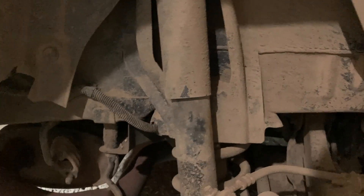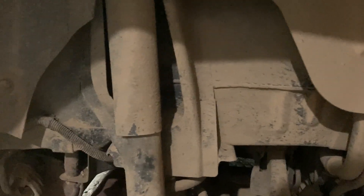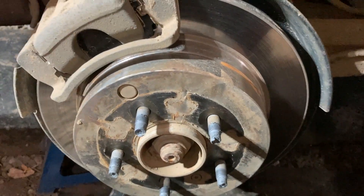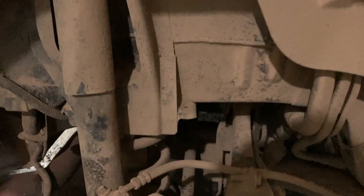It's really dirty in here and I've got to pop some plastic rivets. So I've got my little plastic brush — we're going to go around and knock some dirt off and make some dust. I'll get the flashlight, let you watch, and we'll pop these rivets out, take the panel out, and that'll give us access to the upper bolt. We're two bolts away from swapping this thing out. I'll probably get my little baby jack to put under here — back in my day the shocks are what kept the spring from jumping out.